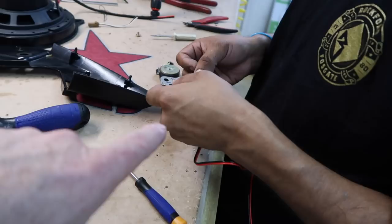And then what we'll do is, just like the fast rings for the door, we take some tall foam and we're gonna put it around the tweeter so that when we push that tweeter into that sail fin, it makes sure all that dynamic energy powers through that hole. Pretty cool, right? Who would have thought? It's just a tweeter. But a tweeter will blow sound everywhere, just like a mid-range will. You might wanna think about putting foam there as well.